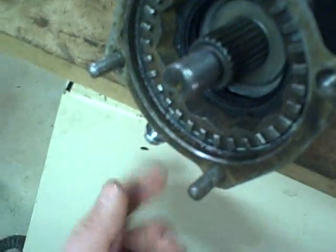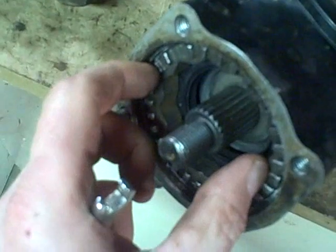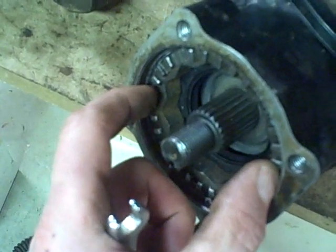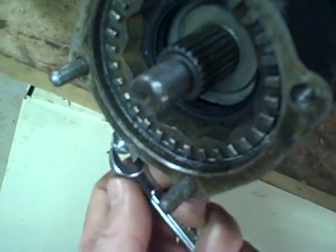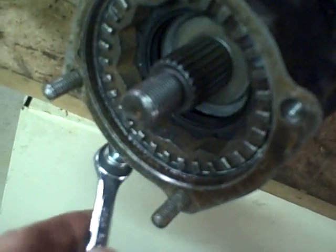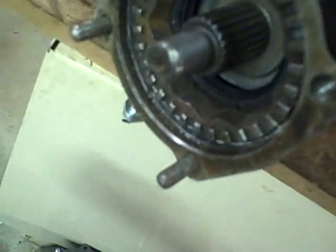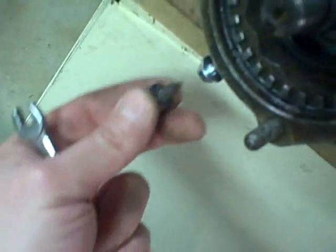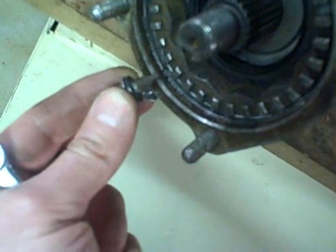Success! What a difference that made. The bearing stop screwed right in — no problem. I used my homemade jig, put a pipe wrench on there, tightened it up, and it didn't bind at all. I could feel it bottom out on the actual bearing and then snugged it up. Now I can take out the temporary 10 millimeter bolt and replace it with the special locking pin, whose little protrusion engages these teeth to keep the bearing stop from accidentally working loose.